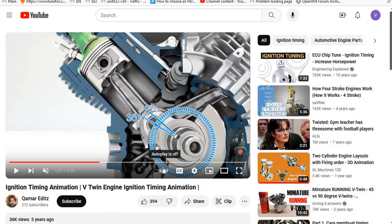What Tuner Studio and Speeduino want to know is, once the gap gets to this crankshaft position sensor, the very next tooth that it's going to encounter as it rotates, how far does the engine have to turn around in the 360 degrees from this point in order for this cylinder to be at top dead center, okay? Well, if it was at bottom dead center down here at 180, it has nowhere to go but up. So as we turn it 90 degrees, it gets to the crankshaft position sensor, but the piston's only halfway up. And so now it continues around to here, and it makes it to the top. That means it had to go 90 degrees to get to top dead center. And that's our important number.